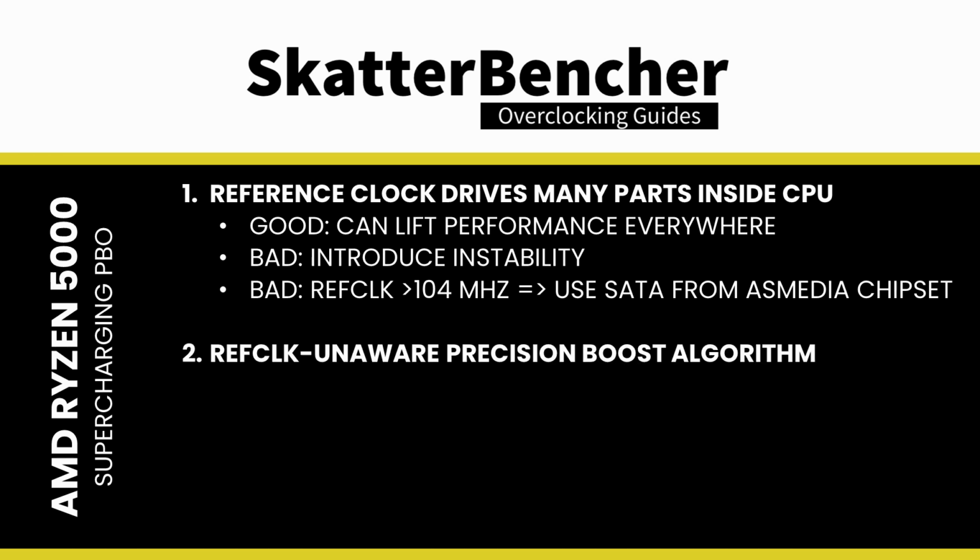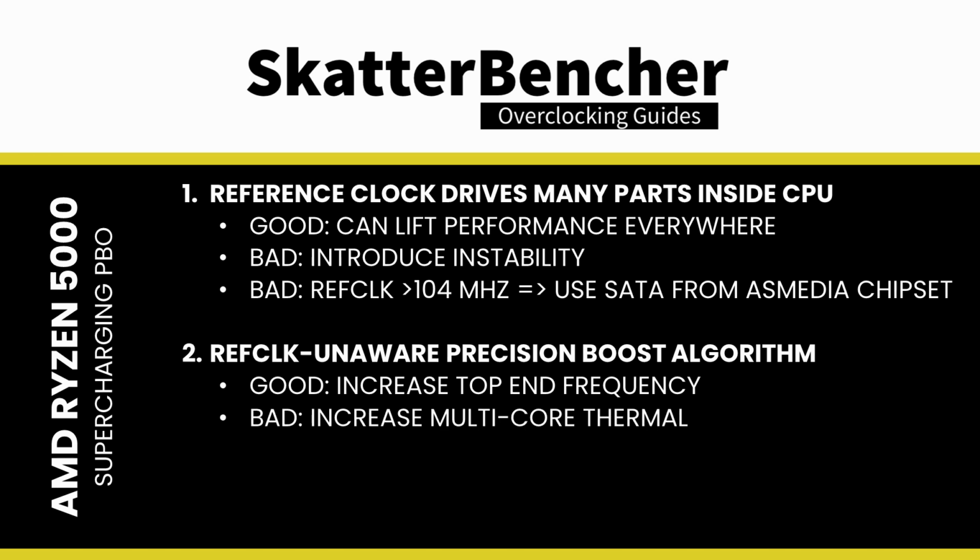Second, as the algorithm is unaware of the increased frequency, it will also not adjust the voltage accordingly. By adding a voltage offset, we can look for stability at the highest frequency range. But keep in mind that adding an offset to the entire VF curve means that you'll also get higher voltage at lower frequencies. In heavy multi-threaded workloads, that means you'll run out of thermal headroom faster than without the voltage offset.